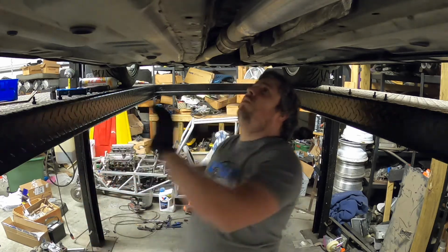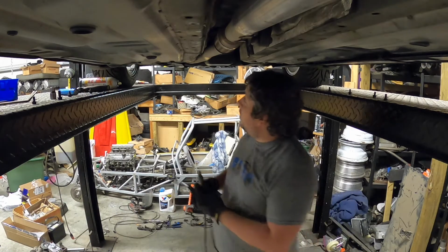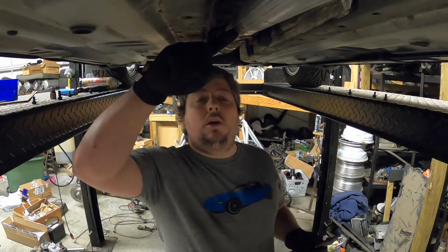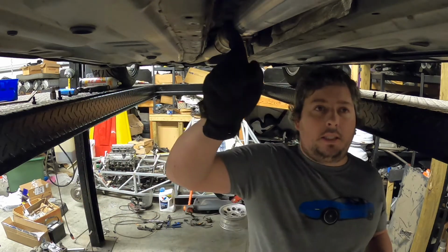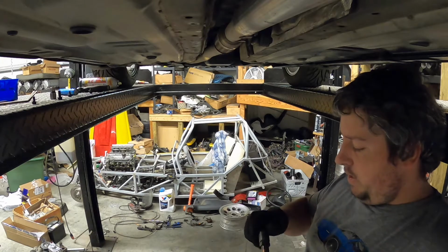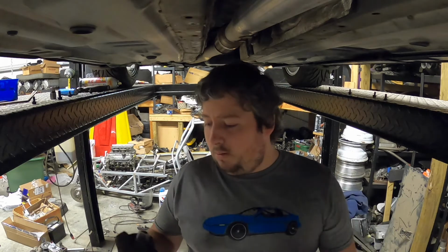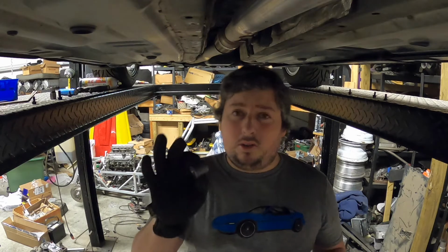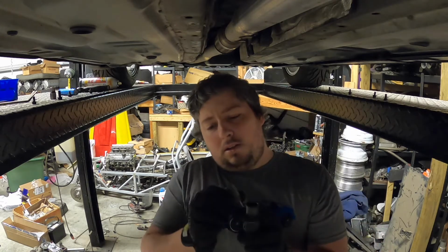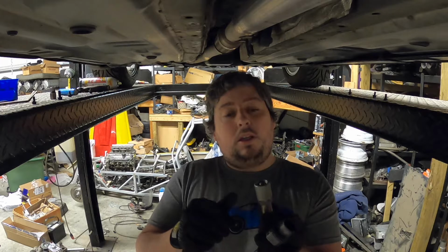Huge bolt. So we're facing a small dilemma here. The downpipe has been welded to basically like an axle back or a cat back system, which I can drop it all off, and that's not a horrible thing. But I want to see where I can possibly fit the O2 sensor, and not against Innovate, the brand, but when you sell a bung that's an inch long, your wideband's really not in the flow of anything if it doesn't stick past. So I'm gonna check this on the lathe and take like half the threads off of it and make it actually get in the stream of flow.